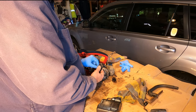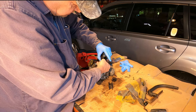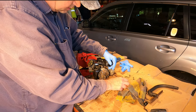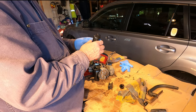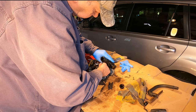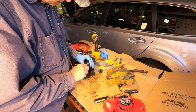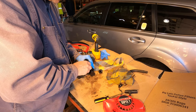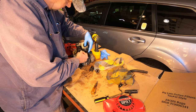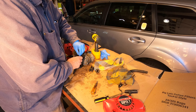I hate to make this much shorter, but since these tubes are stretched out and distorted, they get kind of a bell end shape on them from being stuck on over those barb fittings. This one doesn't actually have a barb, but make that hole just a little bit bigger. And I'll put a chamfer on it. I probably should have done that before I increased the size to see if that would work. There it goes. It's going in.